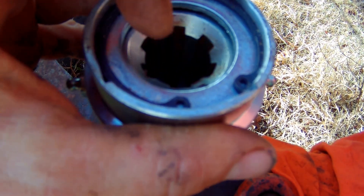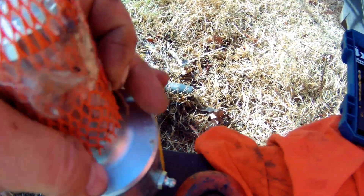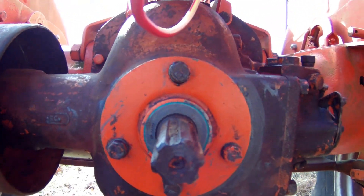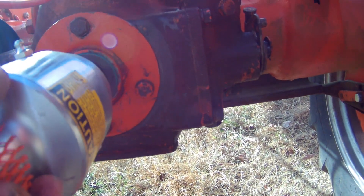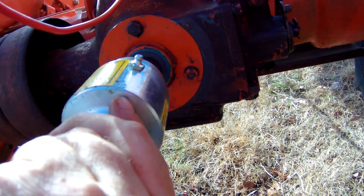What this is, it's kind of a clutch with a ratcheting effect. This one is inch and an eighth, but it's inch and three eighths which is standard tractor size. The older tractors on the PTOs, when you got them kicked in, they only work when the clutch is in. And if you got a brush hog or something hooked to it, it can actually push you forward. That ratcheting effect will let the equipment spin and not push you forward, get you hurt or killed on a hillside.